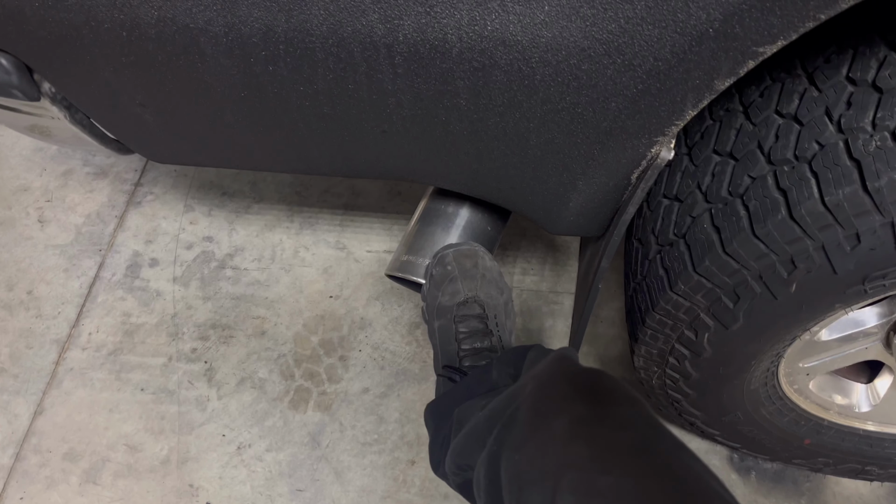Oh, yeah. You mean people thinking that it's a seal leak in the turbo and it's actually blow by because they got a crappy engine? Yeah, pretty much. This one right here. I have a machine shop here, so this is a balanced 10 over rebuild with fresh stuff. But you know, blow by doesn't take much. It's going to be misty. And granted, even if it is a crack like that, who knows, it probably could just be wet for a while, but I don't know.